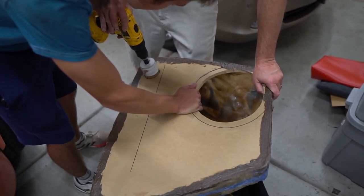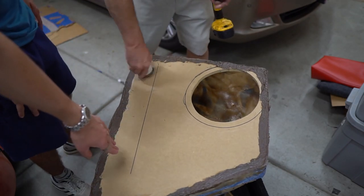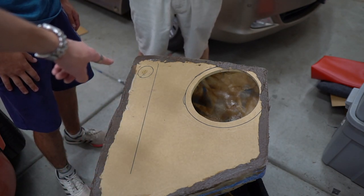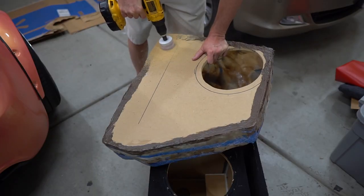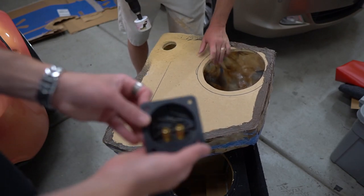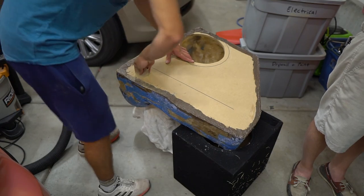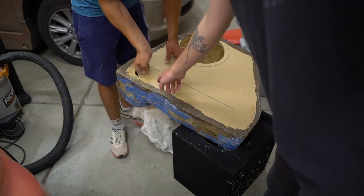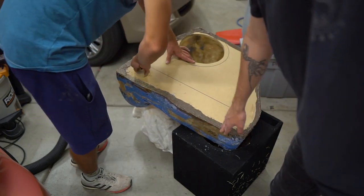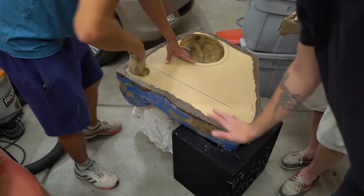What we're doing right now is measuring where the floor of the trunk is going to sit — we've measured across and that's where we're going to attach the terminals right below there, so they'll be hidden underneath. We're drilling out a place for the sub's positive and negative terminals where they're going to connect. Now we're just sanding and fine-tuning, making sure the terminal can drop in there nicely, and sanding all the Bondo Glass smooth so we can't see it when we lay down the red leather.